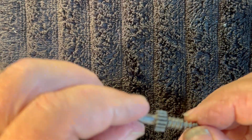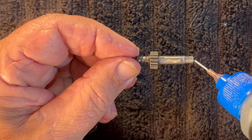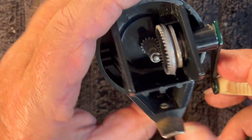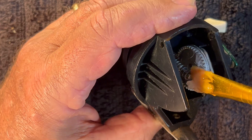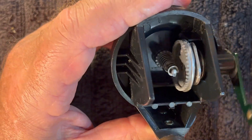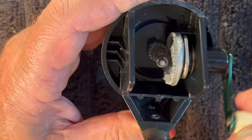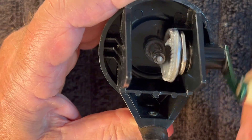We're ready to come back now with our axle shaft and oil the axle shaft. Slide it in to the main housing like so. Get it to mesh with the main gear. Now we're going to come back and put grease on the main gear. If you put it on each of the teeth of the main gear and rotate it around, you're going to get grease onto the pinion. That pinion is going to impact that main gear about four times for every one revolution of the main gear.